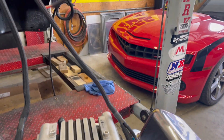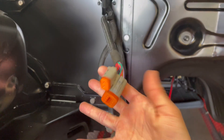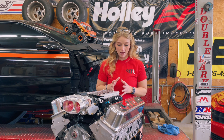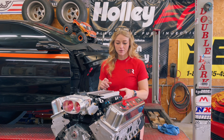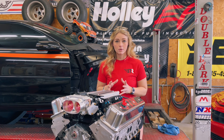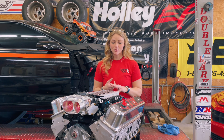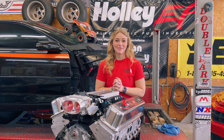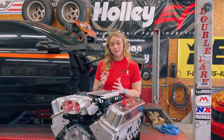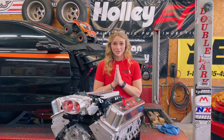I will be finishing this up later once I fully decide what connector I want to use, because it is going to attach to my main harness, and I'm not really sure if I'm going to switch up the injectors and coil harness yet. Huge shout out to both Holley and ProWireUSA for all the stuff they gave me — I will be leaving links down below for both, as well as part numbers for loom, heat shrink, connectors, whatever you need. The fuel injectors I got from Holley are the 100 pound per hour high impedance injectors and I used the EV6 connectors from ProWireUSA. Also a huge shout out to my other sponsors: Jigs, Motul, Smallwood Racing. Head down below for a coupon code to Heatwave for 10% off some new shades or safety glasses. Links to my socials are below — hope you enjoyed this week's video, cannot wait to get the next build series actually going together. Thank you guys for watching.